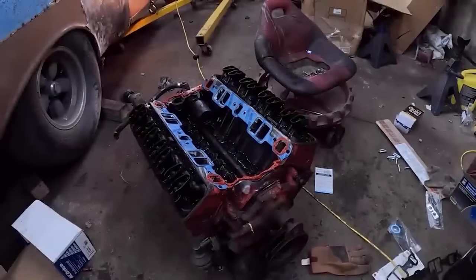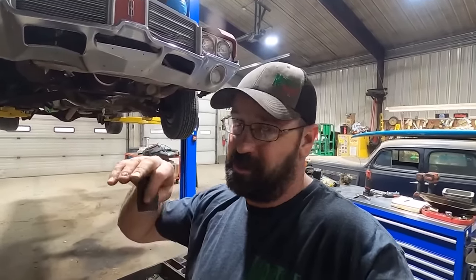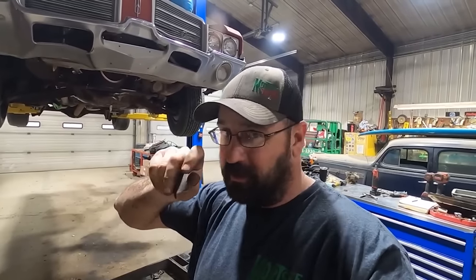Honestly, it's embarrassing. And then he didn't like that, so then he cleaned that up, and then he got the red high temp hideous. Oh man, just complete hack, that guy. Right stuff. Right stuff by Permatex. Best stuff there is. That's what you use. And you just put it on the China walls and a little dab in the corner of the gasket. That's all you need. So hey, at least we're not as big hacks as Discount Disappointment Speed Shop up there in Canuckistan.